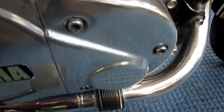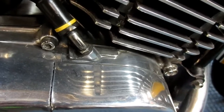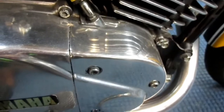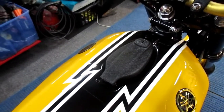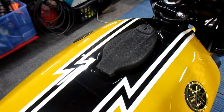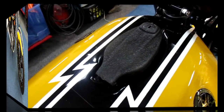The last thing, once this is all done, the oil pump setting has to be verified or changed or brought back to where I want it, which is exactly where it is on a stock engine. I don't want to have some custom setting. And it's always been my habit to add a little bit of two-stroke oil whenever I fill up with gas. I'm not sure that I'm going to have to do that in the future. We're going to find out.